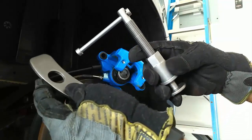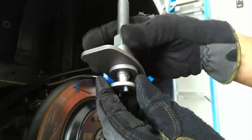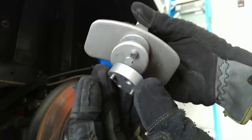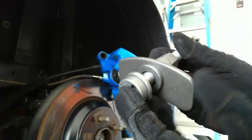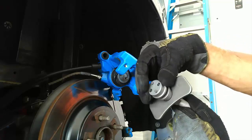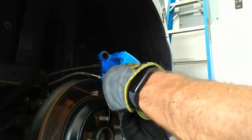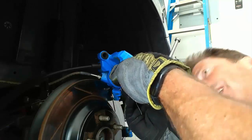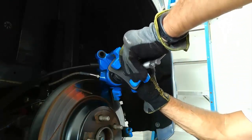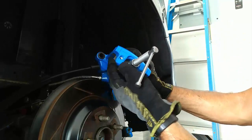The way that this goes together is you put this piece through the handle and it comes down and rides on this, giving back pressure right here. The adapter goes onto this. I'm going to screw this piece down so it fits in there, then line up these holes onto the piston. Hold that in and unscrew this now to tighten it up against the back here. Now we've got that pretty snug.